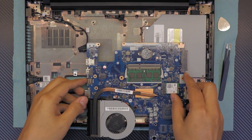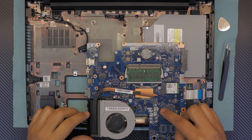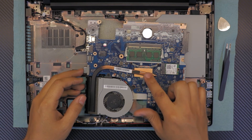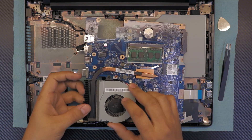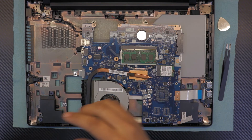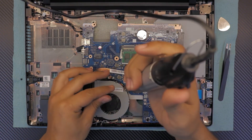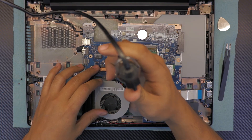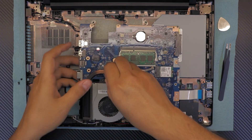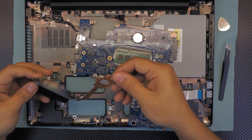Put the motherboard down face-down — that's your CPU, and some people have a GPU installed which would be right here with the heat pipe going over the GPU. In this model there's no GPU, only a CPU. Unscrew the fan and the three screws holding the heat sink, unhook the fan from the board, and remove the heat sink.